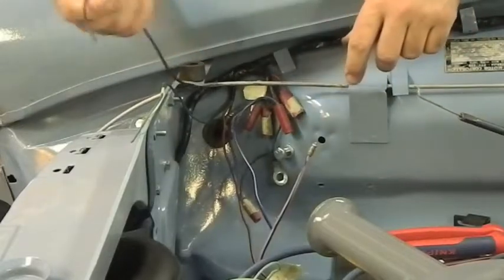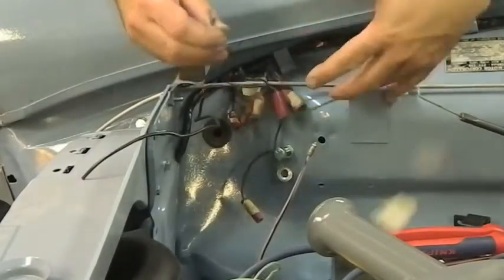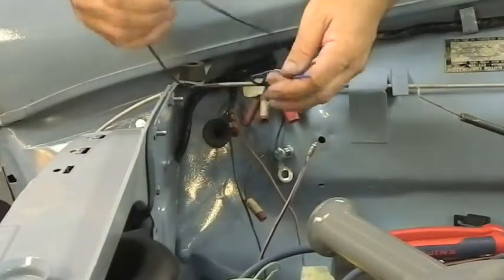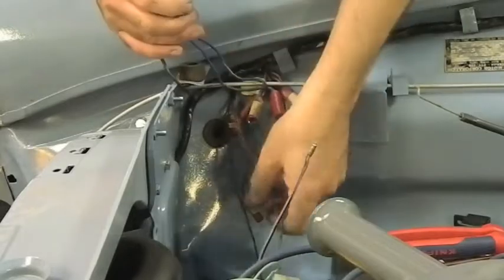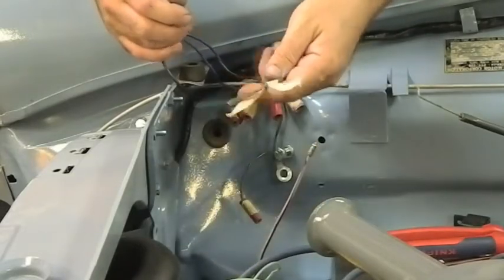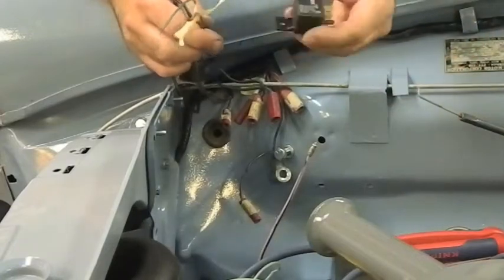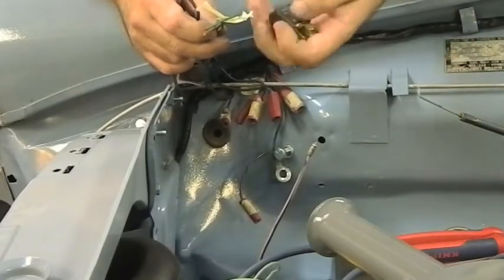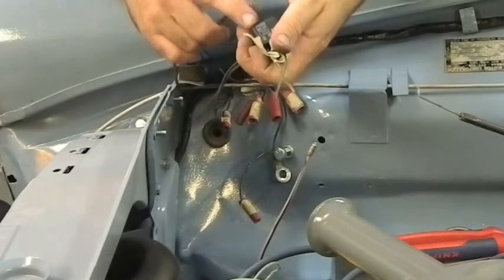I've got a big 25 amp power cable coming that's connected up here. So basically these 2, which were connected up there, are going to have the 25 amp shooting straight down into the headlights, which will give it nice bright light. And these 2, which are from the 2 switches, are going to be earthed against the little magnetic switch in there, and that's what will turn off and on. The switch in there doesn't use much current, so that it'll be much easier on the switch on the dashboard and the dip switch on the floor.